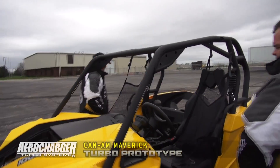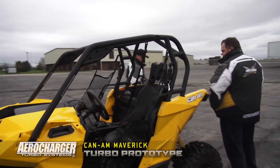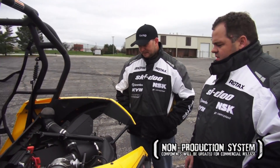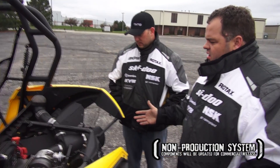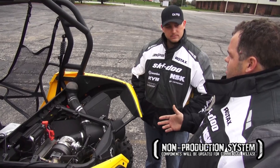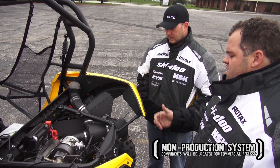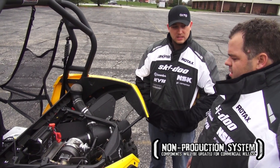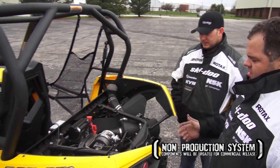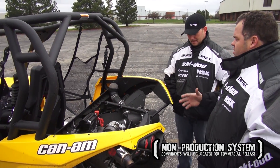We've still got the body panels off of this — it's easier to work on. You come to the rear, we'll do the same thing we've done in a lot of our kits for the off-road vehicles. We'll do a Donaldson style air filter, it'll be oversized. We do have a 66 series turbo on here — that's our bigger one. We're getting lots of exhaust energy out of this 1000cc twin, so we can run a little bigger turbine on it and take advantage of that. This is a prototype exhaust — obviously the whole thing's prototype at this point — but this allows us to take our measurements, get our data, and have more information go to production.